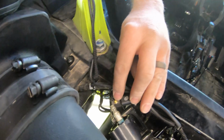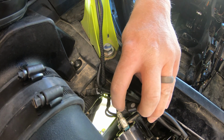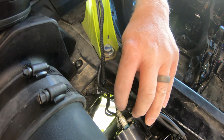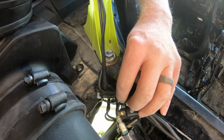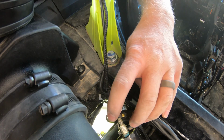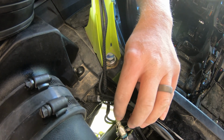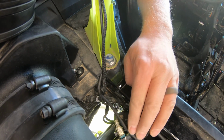There's a little tab right there. You take the screw out, this lifts off, and you just stick it around the wire. You don't peel the insulation off the main wire, just this big heavy protective insulation. The main wire insulation, leave it there. You just remove this so it gets a little better signal from that coil wire.